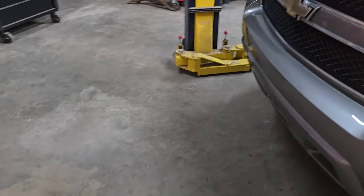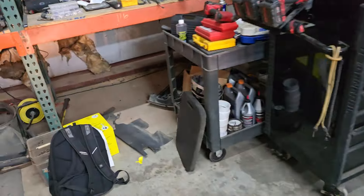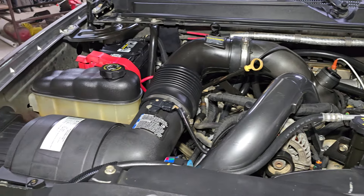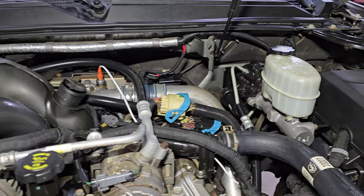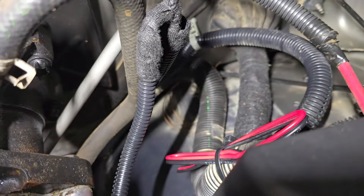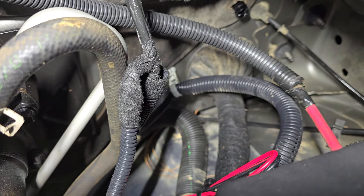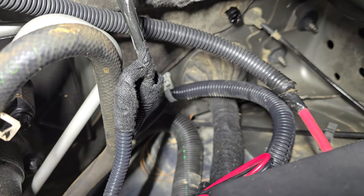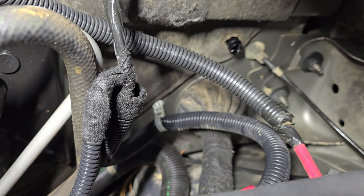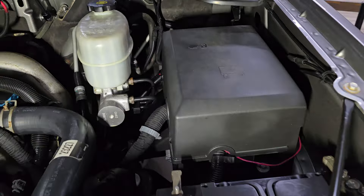Give you a little under hood view. The lighting on that is awful — I'm just gonna get some light. I've installed extra reverse lights and things in the past, and I thought it would be a neat upgrade to have access to the wiring without having to run it after the fact. See all the wiring that I did to interface the diesel harness to the Suburban harness — it went right back through the factory boot, and then it was all pinned.